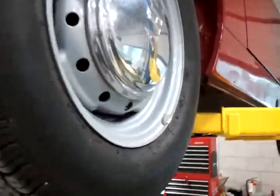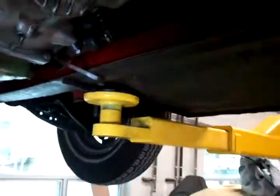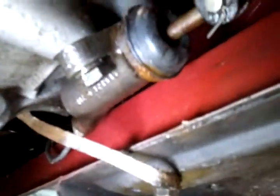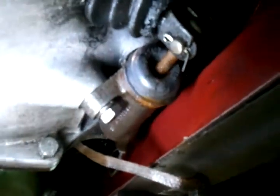It's the Bug Eye Guy, and today I want to take you under this nice bug eye and talk to you a little bit about hydraulic systems and slave cylinders. Now, this nice car has a chronic issue that we found on just about every bug eye that's come through here. And this one, if you look at that rusty band right next to the rubber cap, right about there, if you can see where I'm pointing, that's a telltale sign that this little slave cylinder is leaking hydraulic fluid.